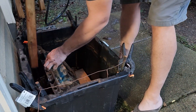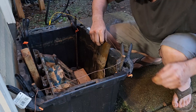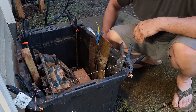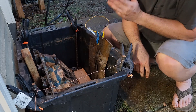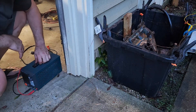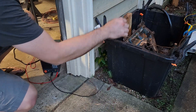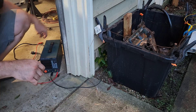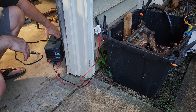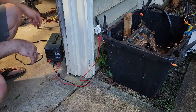I'll use this rod to hold it a little more upright. Now we'll fill it with water. While that fills up, we'll go over the connections. The negative wire will go to the intake itself, over here through the copper wire, because we don't really want to put the alligator clip down in the water. The positive wire will go right here to the anodes. Just remember: negative takes away rust from here, positive goes there — and that's all there is to it.